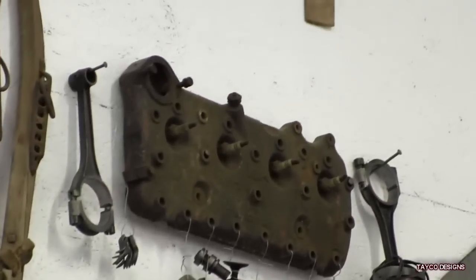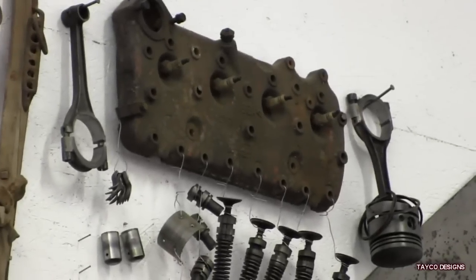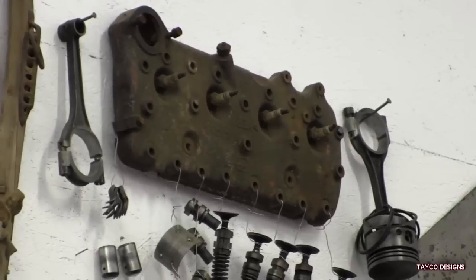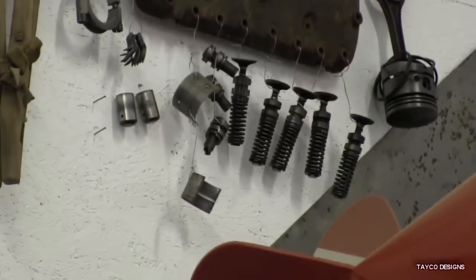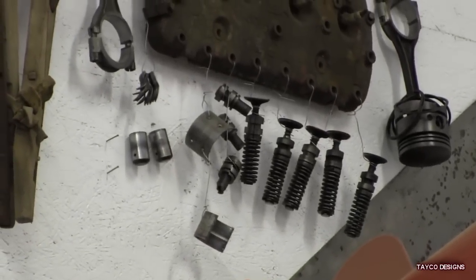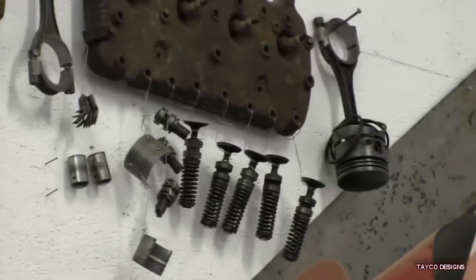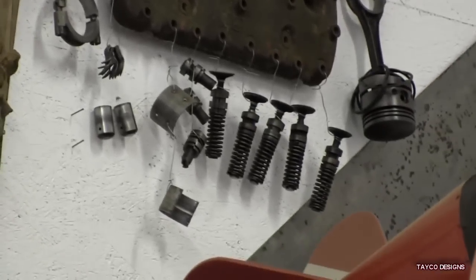Below that is a 60 horsepower flathead engine with a push rod, inverted caps for different parts of the car, and then it's got some pistons with the rings, and those different kinds had rod bearings in them. The Model A's had babbitt where they would literally pour the bearing in.